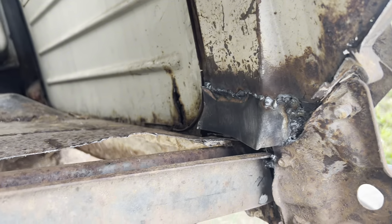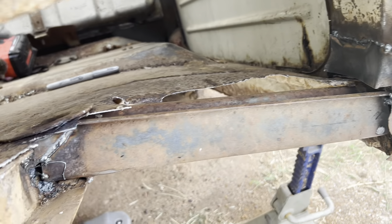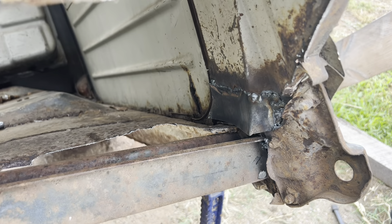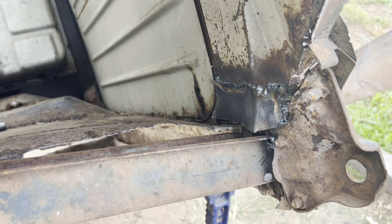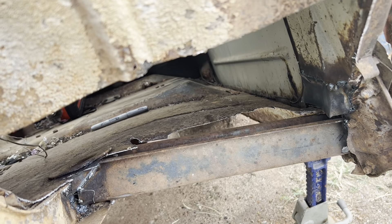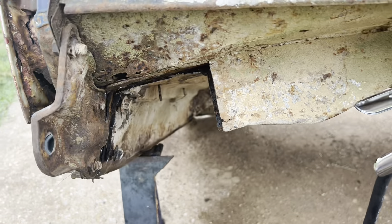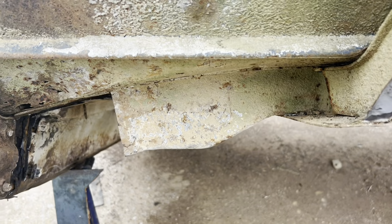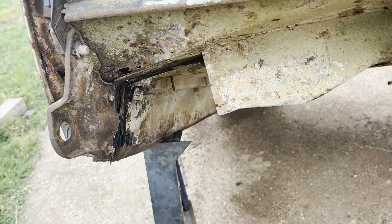There she be - I bridged my welding there. I had to do a little stitch weld. This bottom piece I'll weld in when I put the floor plate in. I know y'all are gonna say I did it wrong - but you know what, it's better than some spray foam, it's better than some license plates. Rust is gone on that part, and it'll be covered up anyway. Next thing, I need to get some metal for this. Should I use the brace on that one? There's the right height, but over here it's thicker - I could bend something up and weld it on. Let me ponder on that.